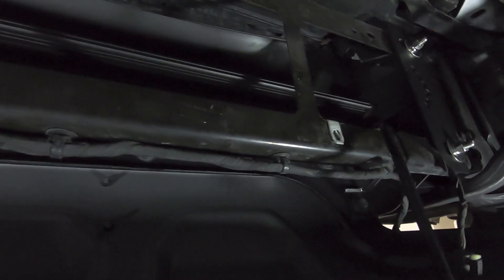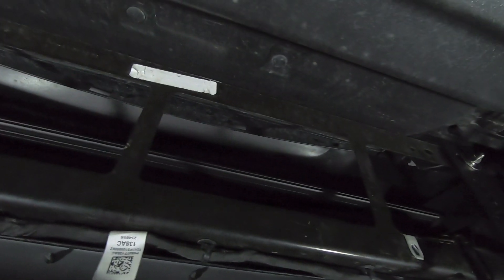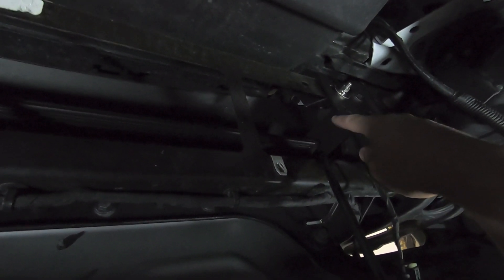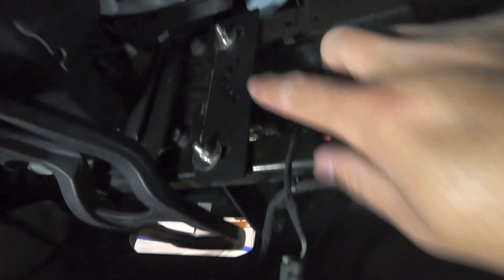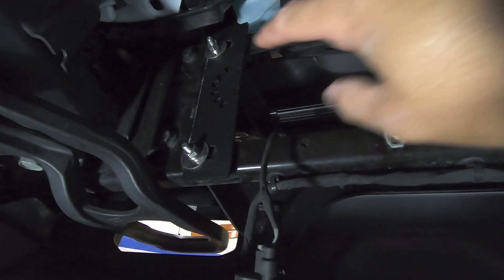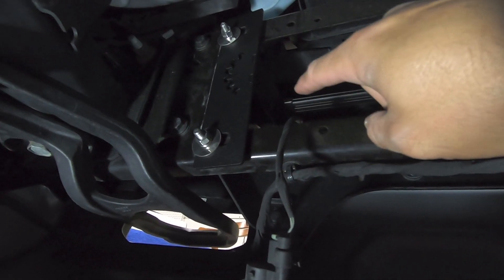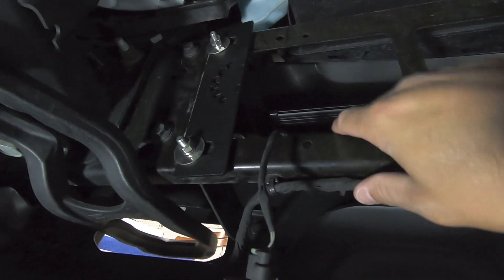As far as the install process, you've got to be kind of tricky with this one. First thing you want to do is slip your 30-inch light bar up in behind the grill where it's ultimately going to live. Then take the end screw for one side of your light bar bracket and attach the bracket to the light bar with that end screw. Then do the same thing on this side. You don't want to put these bolts in yet until you get the screw through the Shifts & Grind bracket into your light bar — that way you have the ability to move things around. I'm using a single row light bar; if you have a double row it's going to get a little trickier, so a single row might be the way to go.